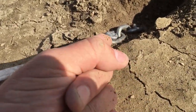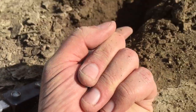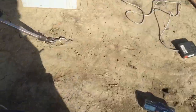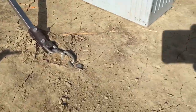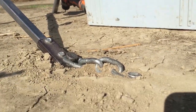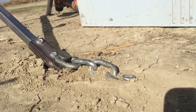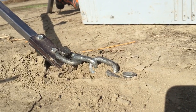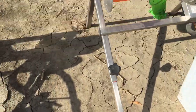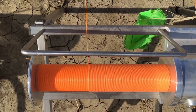This is very important because now when we're pulling like this, it doesn't lift this nail — because when the chain is flat like that, the nail wants to lift. I'm going to show both with full winch tension. Here is the one that is wrong. You will see this nail shift, the winch shift, get lift. It's pulled forward probably a full half an inch. You can look at the line and it is not at a 90 degree angle. Bad winch mount.